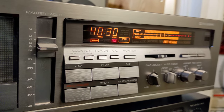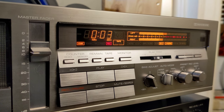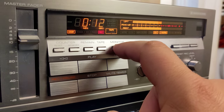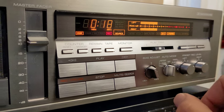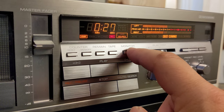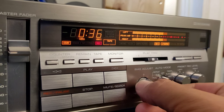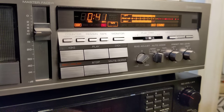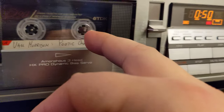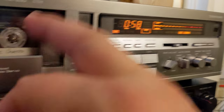I'll keep my bias knob a little bit to the left and see how it records. The level is a little lower but the bass will come back. I'm switching between source and tape to compare. I'm chasing the tape source to be similar. This is actually an excellent cassette deck — the sound is really good. You can get very good and decent sound even from a basic normal tape that's old.